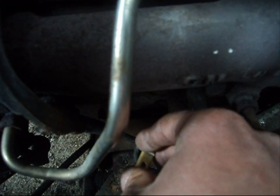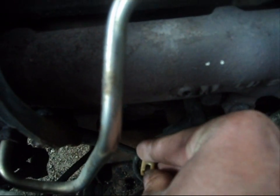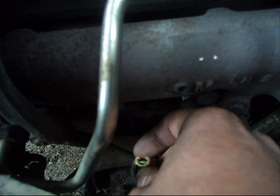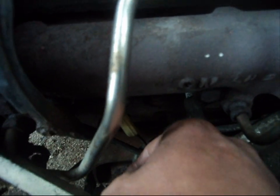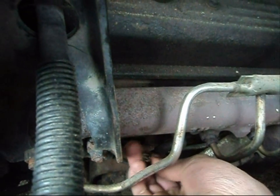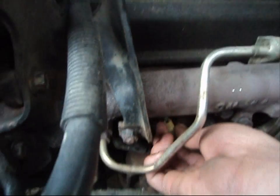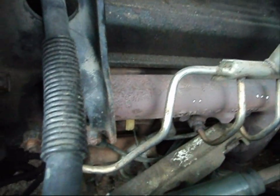If you own a Caprice, and this message goes to the gentleman who sent me the email. I don't think you have a YouTube account, and I don't think you're a subscriber, but anyway, this goes to you. Just make sure that this is clean and make sure it's connected, because if it's unplugged or if the pigtail doesn't even exist, well, that's part of your problem right there. Okay, so once you're done with that, you can use a terminal cleaner, like I have, a can of battery terminal cleaner. I just spray on and work it in. Let it dry and just plug it back in. Just like so. That's why your coolant gauge doesn't work.